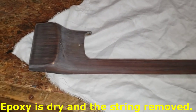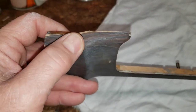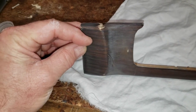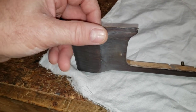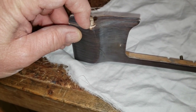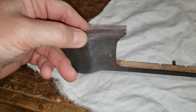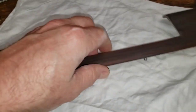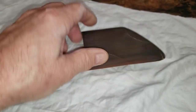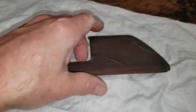Did a little more sanding with 100 grit, then stepped up and did some wet sanding with 600 wet/dry paper. It looks rough but it's actually smooth. This is where the wood veneer cracked because at the factory they had to take this veneer and bend it around - the door panel trim comes in and lays over the top, so you don't see this corner. Up next we're going to put a little stain to cover the spots where bare wood is showing, then after that dries we'll put three or four layers of polyurethane on.